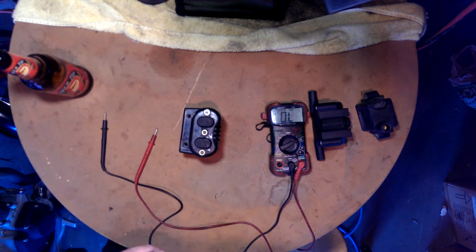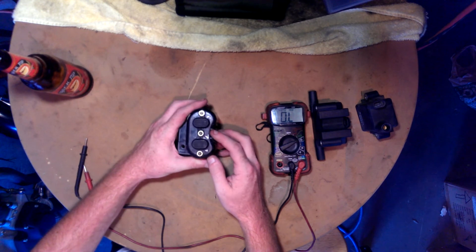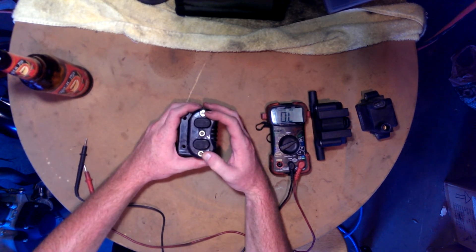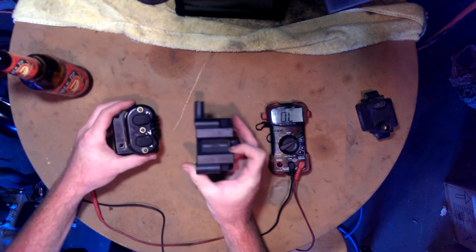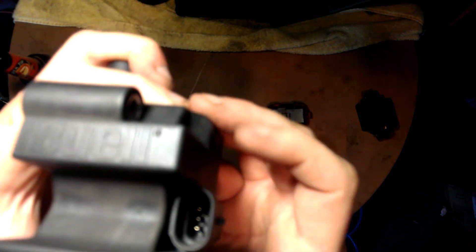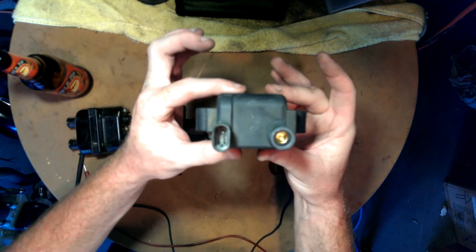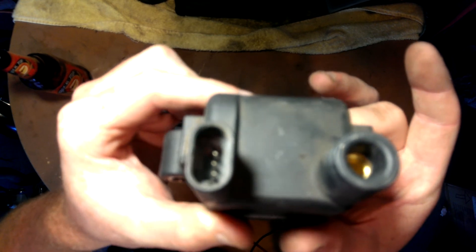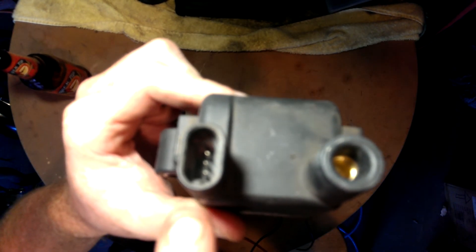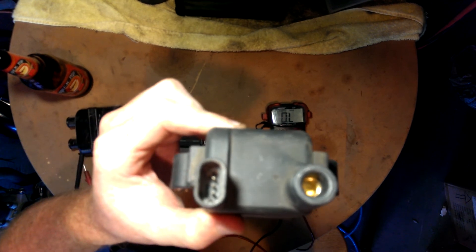So you're checking between your signal wires — the outer plugs. For you XB guys, both of your outer plugs — those outer little pins — both of those are your signal wires. You should have a half ohm resistance between those and the center plug. That center pin is your plus 12 volts. Blast guys, when you're looking at this one — see how it's oriented — that center pin and the one on the bottom side. Between the center pin and the bottom one, that should be 0.5 ohms.